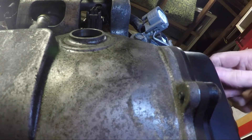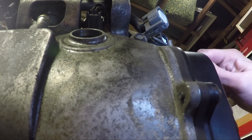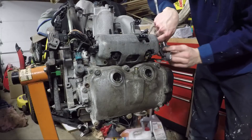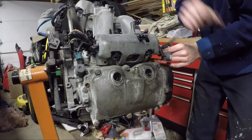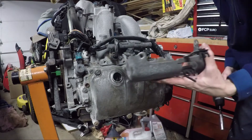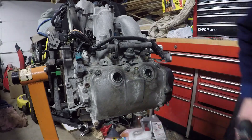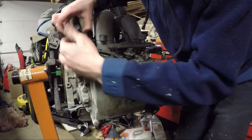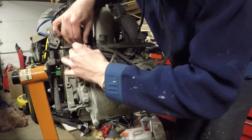Once that's out of the way, I removed the O2 sensor connectors from the front — they're held on by a little tab that needs to be lifted and the connector slid off the metal bracket. Then I removed the metal fuel injector covers. Originally I tried removing the wire harness before the intake manifold, but it was very annoying and turned out to be a waste of time. It's much easier to remove the intake with the harness still attached to it.